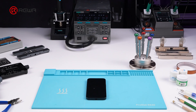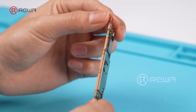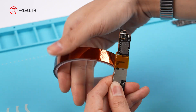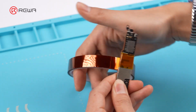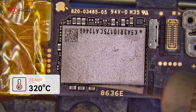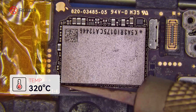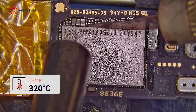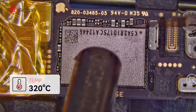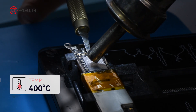All repair tools you can locate on our top comments. First up, the NAND. The CPU isn't positioned behind the NAND, significantly reducing the risk of solder joint failure. Protect the motherboard edges with high temp tape. Secure the logic board in a PCB jig. Blast hot air gun at 320 degrees Celsius to clear the adhesive around the NAND.